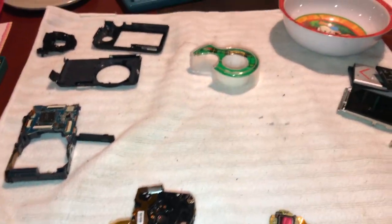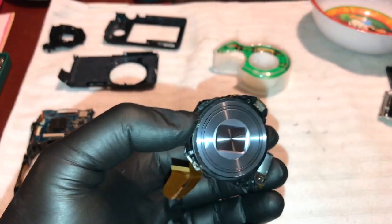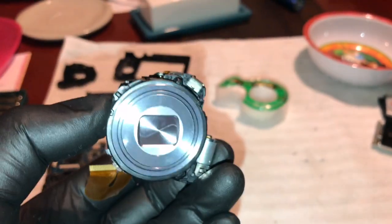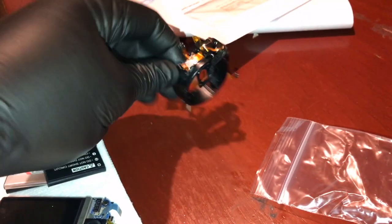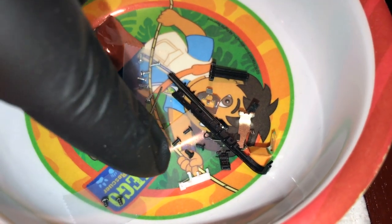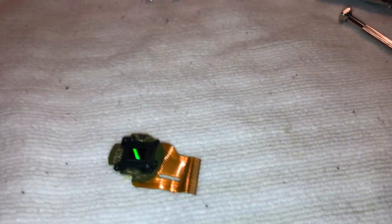So I'm finally going to sit down and fix Thomas' camera. These are all the pieces. Everything is in working order, except I could not clean this assembly to save my life, so I ended up buying this off eBay — it's supposed to be a genuine Sony part, but I don't know if that's true. It looks pretty clean though. Here's the actual CMOS image sensor, and this is the old housing. You can see how many individual pieces there were — it was a nightmare. I'm going to clean off the sensor with some scotch tape to make sure there are no particles on top, then we'll start putting it together.